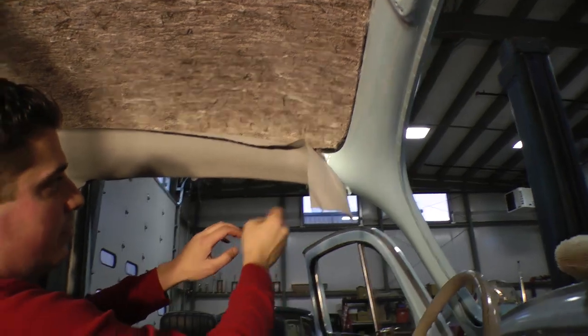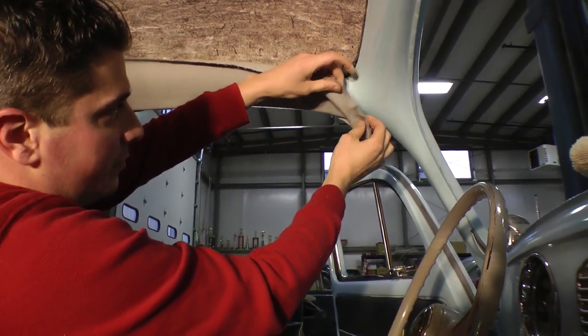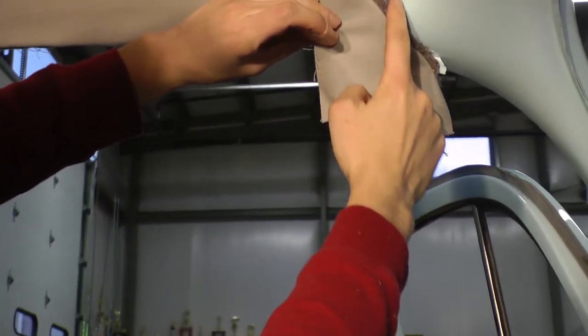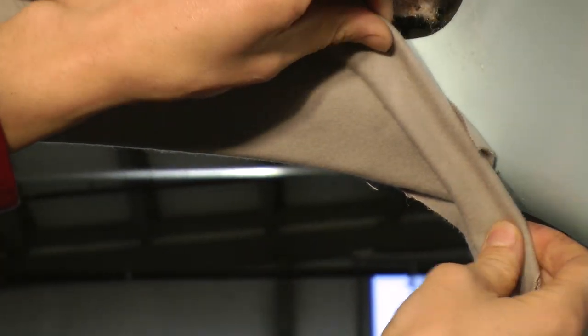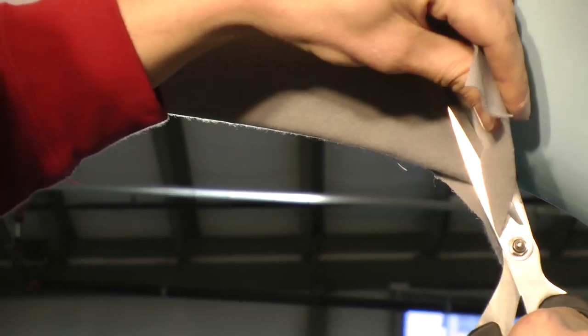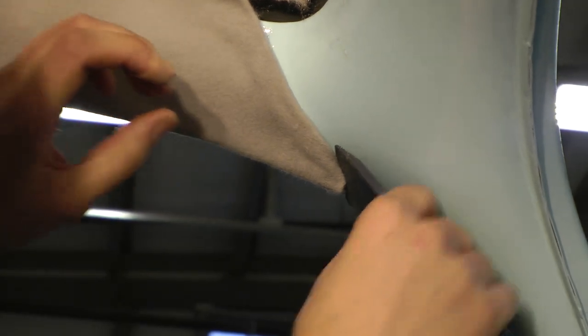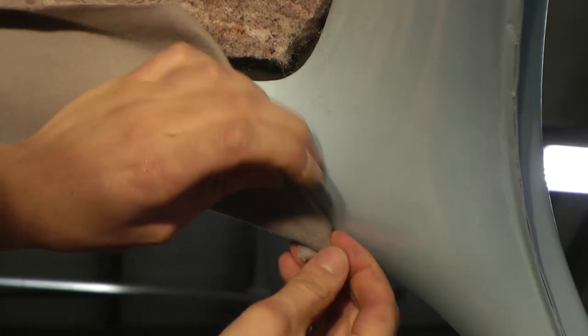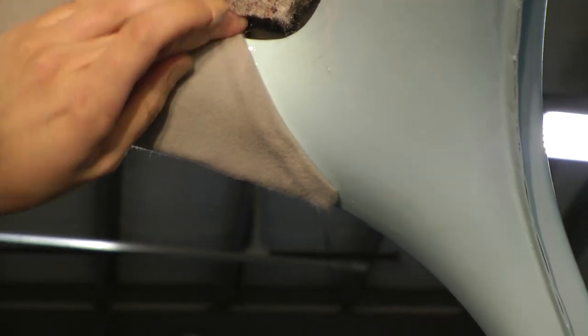The last part of the pillar area - before we finish tucking in the front teeth, I usually leave this a little loose. We've got to do a tuck here. Here's the diagonal line like I showed last time when we put the padding in - we've got to do the same diagonal line but tuck this to get that line. Cut that off, then cut a diagonal line and curl that in. Most of these grippers you can put up by hand - push that up to get it into place, and there is your tuck.